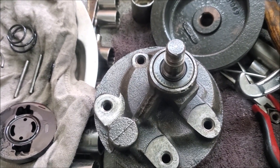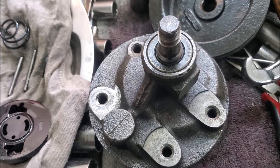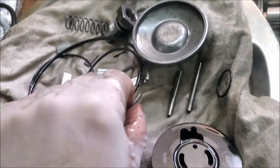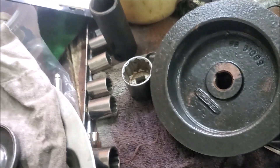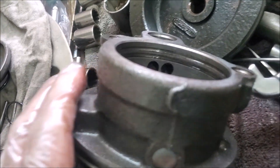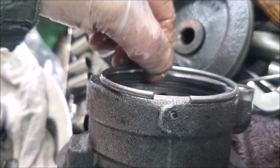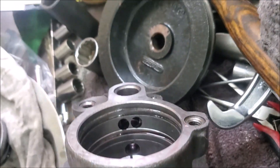I'm going to put this in my press, push it out, buy a kit, and then rebuild it. There's really no point making a video on rebuilding — it's more or less the reverse. You will have issues with the spring-loaded cover: people say get a G-clamp, clamp it down, put this ring back on there and you'll be alright. A word of advice: make sure the ring doesn't cover that little hole where you push your pin in — you may want to have it at 90 degrees offset so when you remove it next time you won't have a problem.